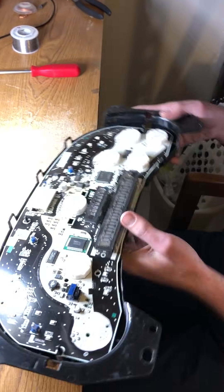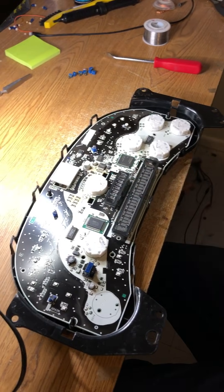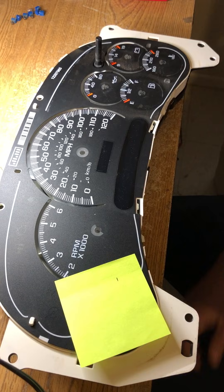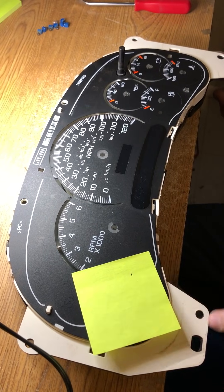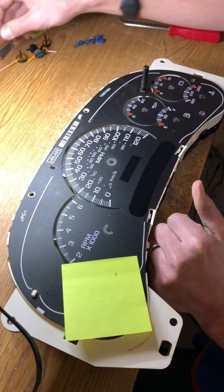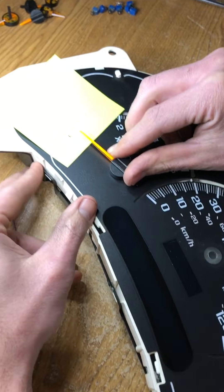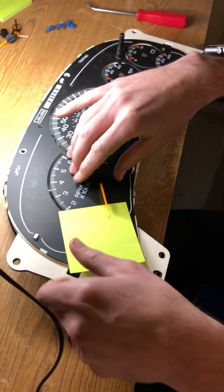So we're ready to put it back together. I recommend while you've got it open, just grab a rag and wipe off these two displays. Snap the face back on. You might want to clean your lens while you're in here — be very careful not to, depending on what you use for post-its or tape, make sure not to pull those up, otherwise you won't know where to put your needles back to. Go ahead and place the needle on — always turn counter-clockwise when you're adjusting it. Look down the needle, line it up with your little mark, then you can remove the post-it.